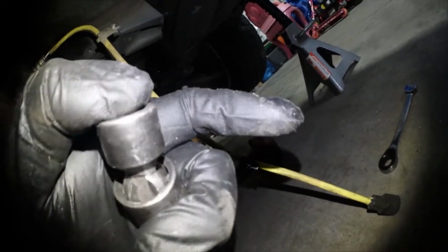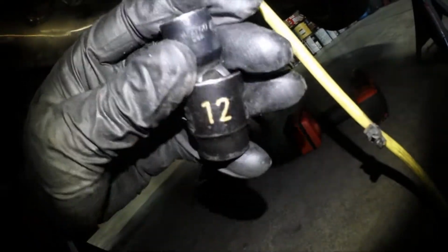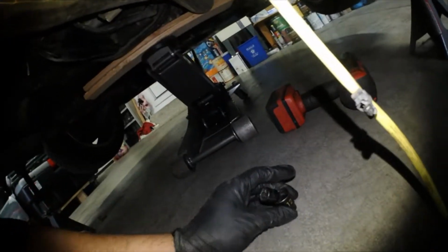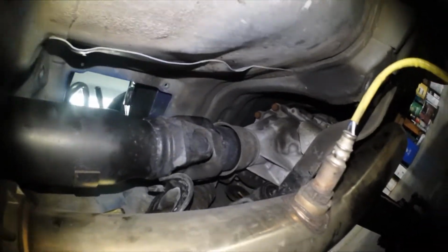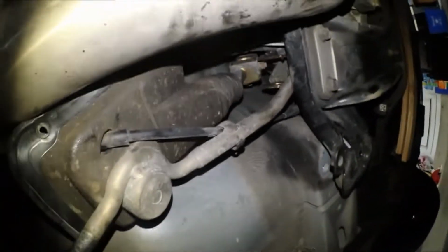So these are wobbly sockets. These are from Matco. They retail for $300 and something for a full set of 3/8, and these are 365 degrees rotation. They're worth every penny, because that's how I got that rear bolt out. I used this 12, or no, this is a 14, but over here I used this 12 mil one, and it was fantastic. These I use at work all the time. I can't stress this enough. I recommend this to anyone who is working, especially on a Subaru, because everything's just so tight. But yeah, let me go ahead and just kind of work my way up.